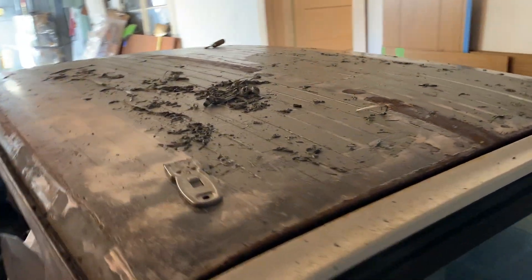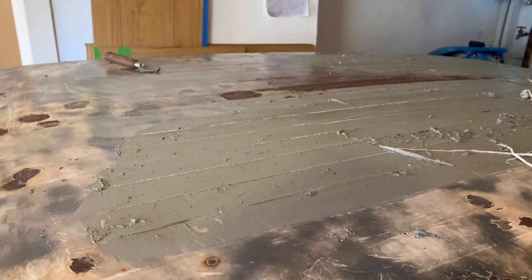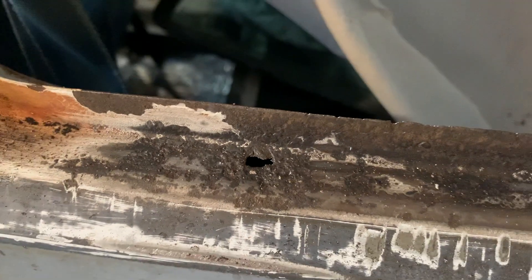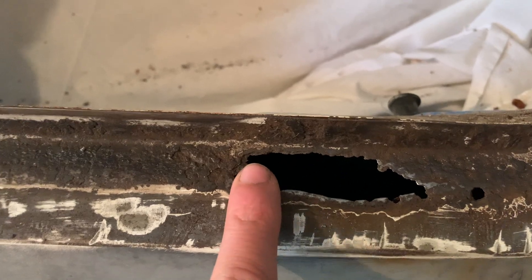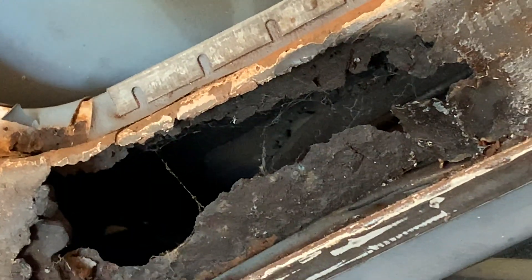So now we're gonna use some paint stripper. Hopefully that takes all this gunk off instead of us just cutting up our fingers. We sanded this bit down some, just gotta patch that hole up. We actually found another smaller one over here — that one's not gonna be too bad. Probably just snot weld that. This one I'm thinking about doing some chicken wire in here and then putting fiberglass Bondo or something like that — try different styles of bodywork. That should probably hold up, could probably weld that, but we'll see.